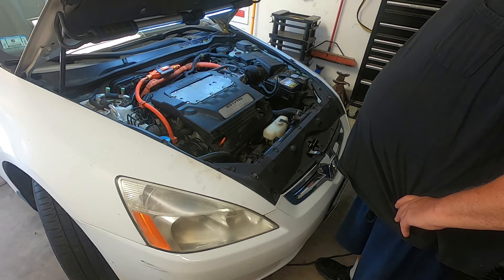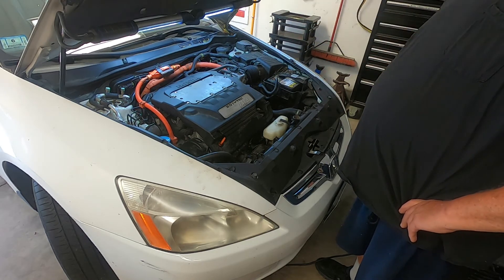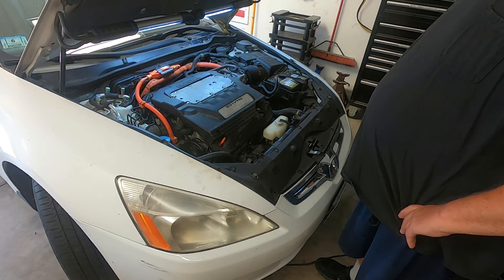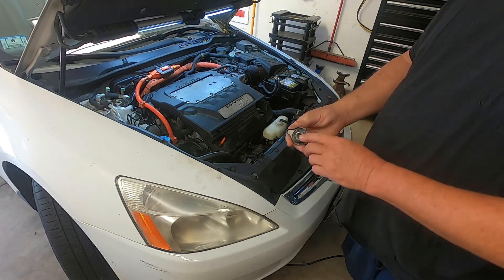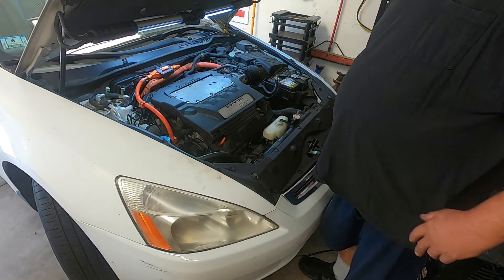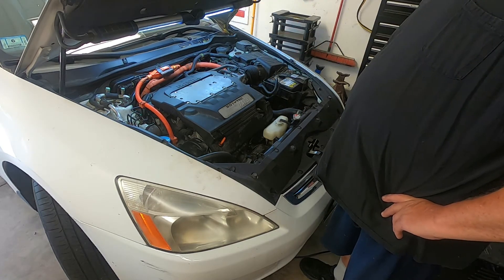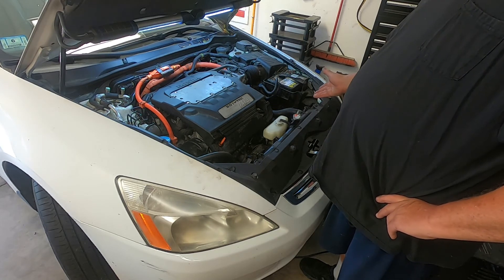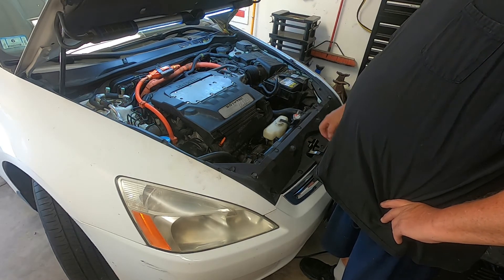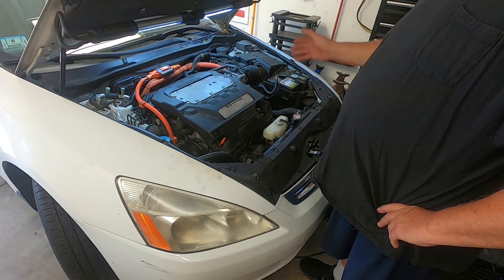I'll have to call them and give them the bad news. If they do decide to repair it and replace the head, the next step would be a compression check to see if it's one or both heads. The other thing I noticed is when I pulled this radiator cap, the cap was broken — it wasn't working. So that is probably how they were losing coolant and why they were carrying coolant with them. I think they just let it go too low on coolant, overheated it to the point where they warped the cylinder head, and then the PCM — the power control module — detected the problem and shut the motor down.